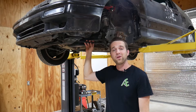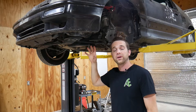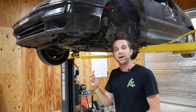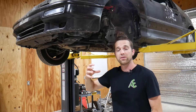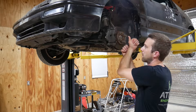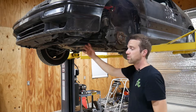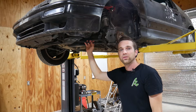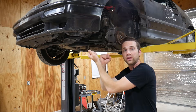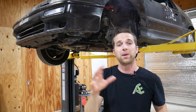This link is a great example of being in what I call the load path. When you accelerate, torque is generated by your engine and sent through the tires into the ground. That torque fights against the inertia of the car that wants to sit still. This rod sits in between those two forces and it's going to compress — basically squish — whenever you're accelerating. The exact opposite happens during braking, and the strain gauge is going to pick up both of those.